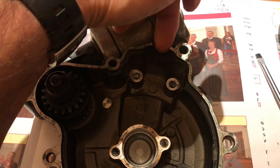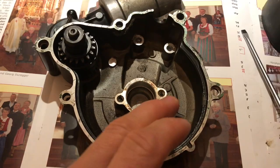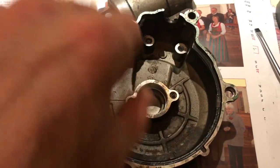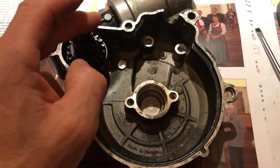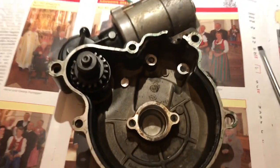Then you can fill this up with something like gear oil — I think it's 100ml, but check out the Slavin's Racing video for the exact volume. You've then actually got oil sloshing around in there all the time, which is great because it keeps everything coated. It's a bit rusty and manky in there anyway.